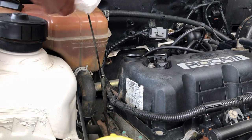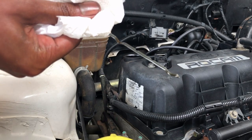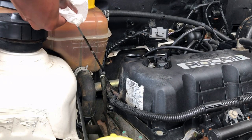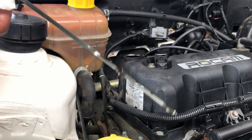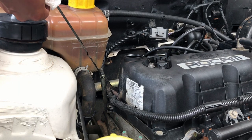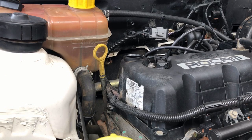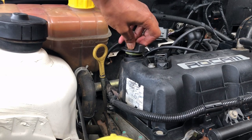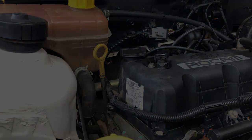With the oil in, the next step is to check the oil level. It's best to put it on the full mark. I have cleaned the dipstick before checking — as you can see it's on the full mark. There are two indents on the dipstick: the lower and upper mark. Once the engine has started, some of the oil will circulate through the system and the level will drop, so don't worry about it. Keep it at the full mark or slightly overfill for now, but remember too much oil can be a bad thing and too little oil can be a bad thing.